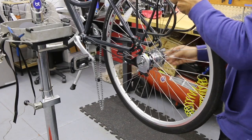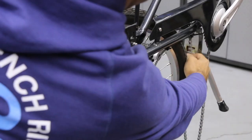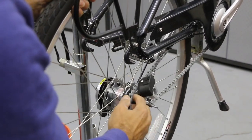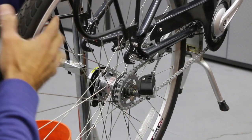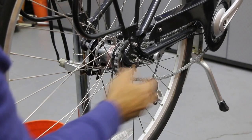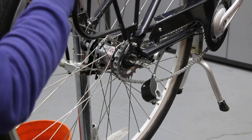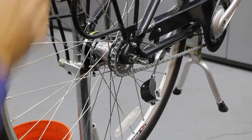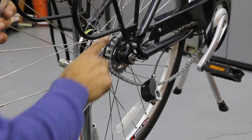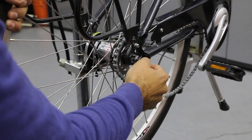So we're going to come up. At this point I'm going to go ahead and grab my chain and put the chain around that rear gear. The chain should be coming over on the right side of the wheel. I'm going to raise the wheel up — left hand is controlling the wheel and my right hand is guiding the chain onto the gear. Then we'll slowly bring this up. The shifting can stay last, that can just stay out of the way. Then we're going to rotate — if you have a bolt, you can back the bolt off or have the bolt off completely. Back that off. Same with the gear bolt on the right. So once that's up, I'm in the dropouts there. The chain stayed on the rear gear but it just came off the front chain ring, which is okay — we can always go back to that.